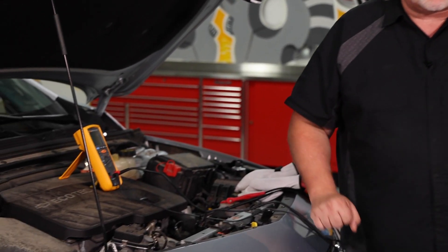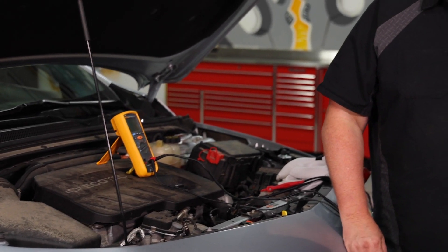Nothing's coming up here to the front. One of the issues with doing an insulation test is if there's any voltage on that cable, the test becomes invalid. What we're going to do is induce voltage from our meter right here — this is a special meter called an insulation tester, and it's going to put 500 to 550 volts into that cable.